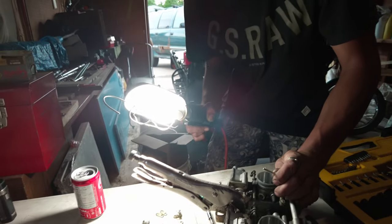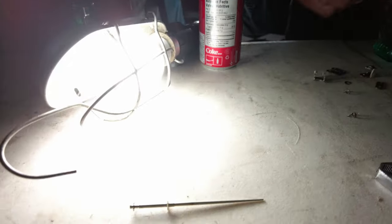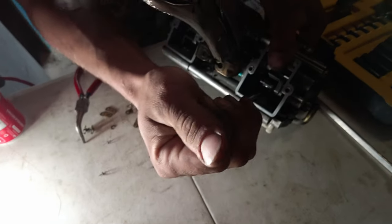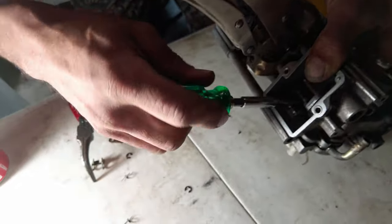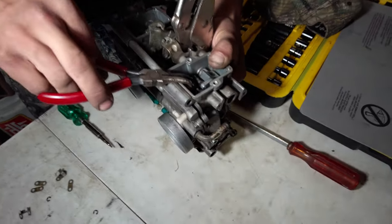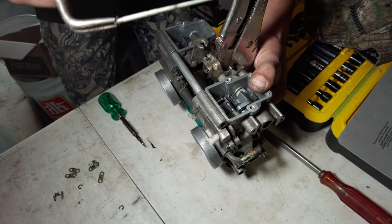And that is on the left carburetor — this is going into the engine, so second groove. We'll go ahead and take this side up, if we can wiggle it up. Get that Torx key in there — it's pretty tight in there, kind of surprised. And there she comes — it's in the second groove from the top as well.